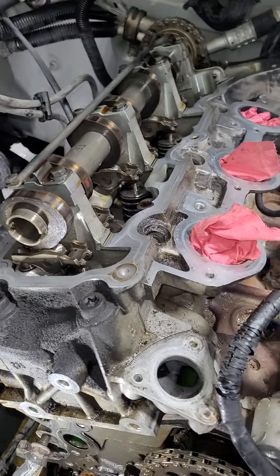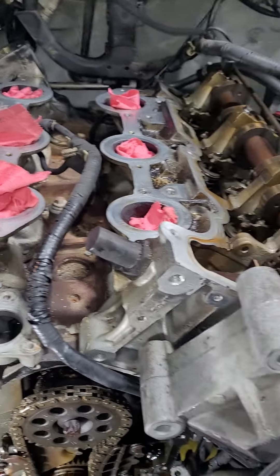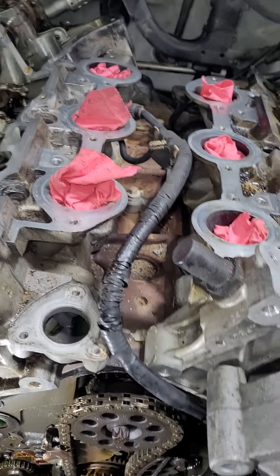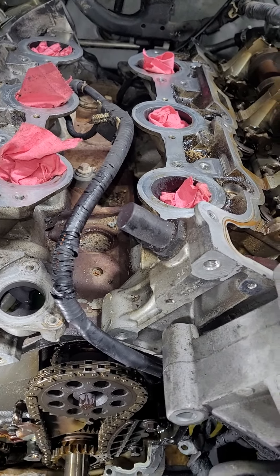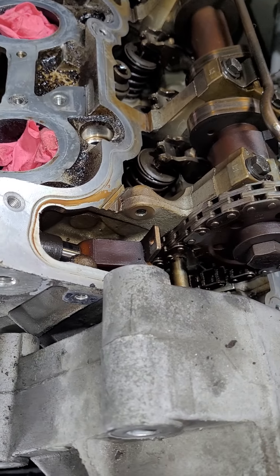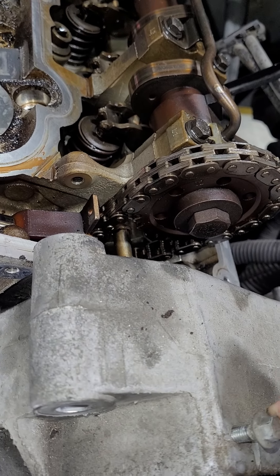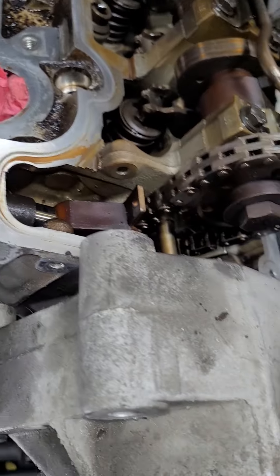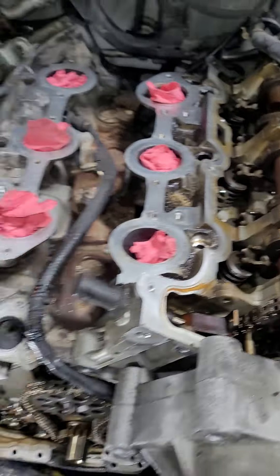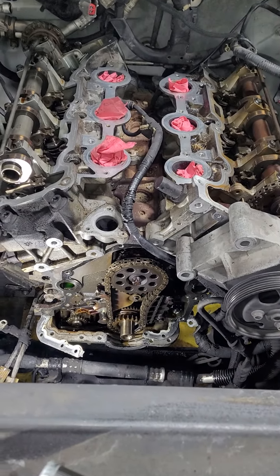I've got to give it to Ford. A lot of guys have a problem with these engines where the chains just explode — the cassettes explode and the car shuts off, that's the end of that. This one, it never happened. It ran, it kept running, and I finally said it's time to do them. When I take it all apart and get the cassettes out I'll show you those, and we'll marvel together at how insanely worn out they are. 2004 Ford Explorer with the 4.0 timing chain job. See you guys later.